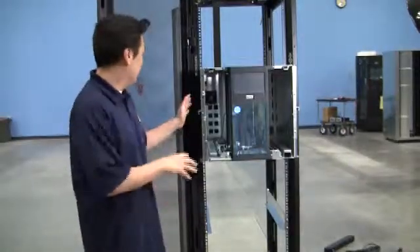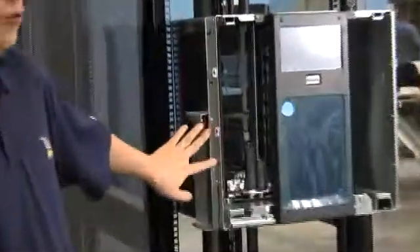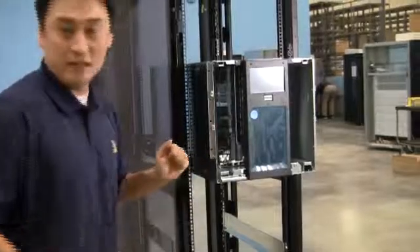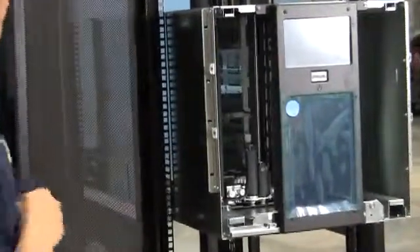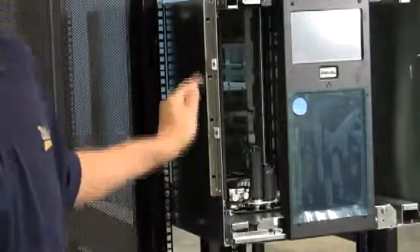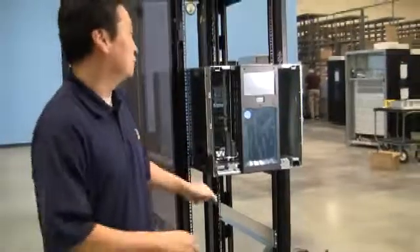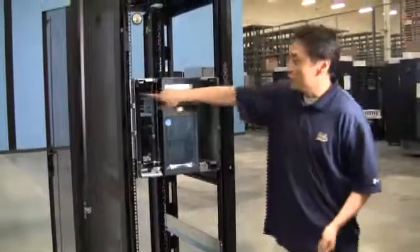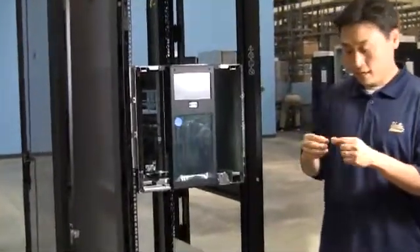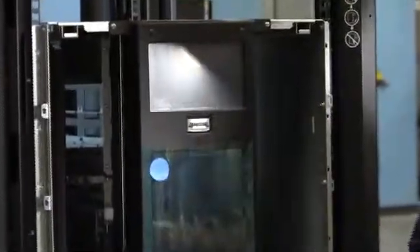After placing the library into the rack — you can see here it's halfway in, just sitting on its slides — go ahead and remove the handles by removing the screws on either side. After removing the handles, you'll see the library's edge has four screw holes. The library comes with two additional screws to attach it to the rack; you don't need all four — just pick one hole on the right side and one on the left side. Push the unit the rest of the way in, then place the rack clip on the inside and put your screw through to tighten the unit down into the rack.